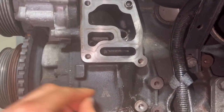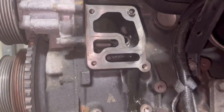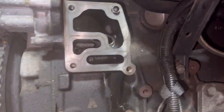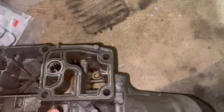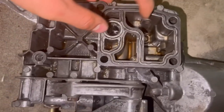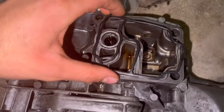So you guys can see it's all pretty clean right now. There's some leftover gasket residue over here — I just used a little thin blade, and you have to be very careful and very gentle. I cleaned up around here as best as possible and now it's ready for the fresh gasket to go on. It's still going to be a little bit oily in here, but it's pretty clean. Now I'm taking the new gasket and setting it in here.